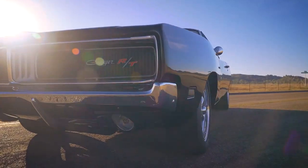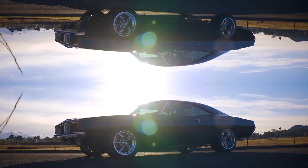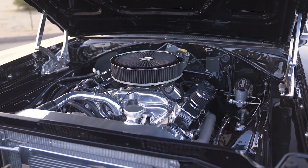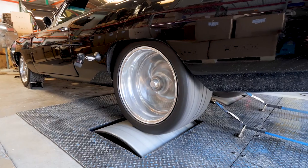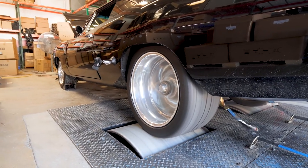What does that mean? RT was road and track. In '69 they made about 80, 90,000 of these Dodge Chargers, and only about 20% of those were optioned as an RT. Those came with two different models — a 440 or a Hemi. This came with the more powerful 440, coming off the factory floor at 375 horsepower. The engine in this particular car is a period correct 440, meaning it's also from 1969. It's been bored and stroked out to over 500 cubic inches and recently was on the dyno with over 520 horses at the wheel, probably over 600 at the crank.